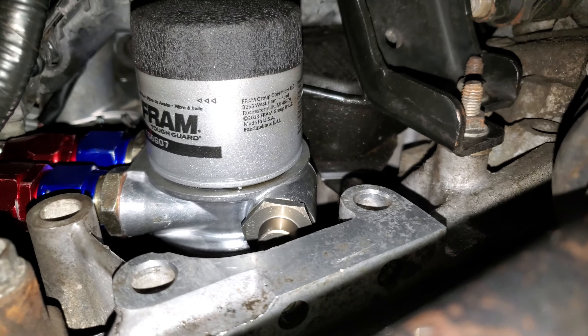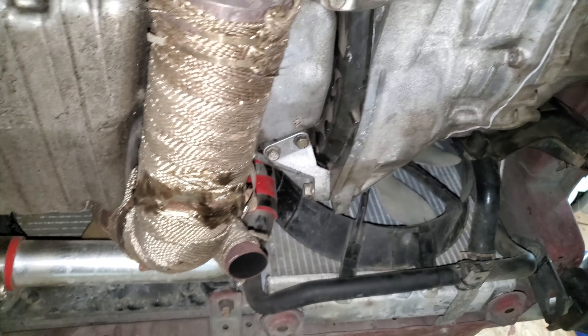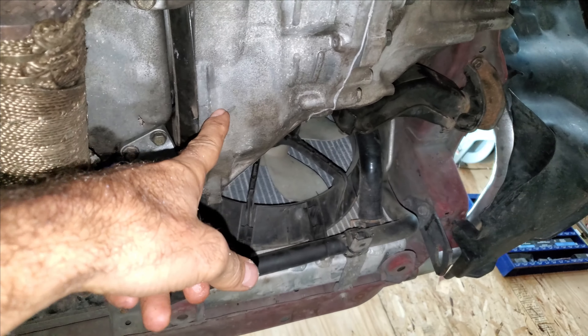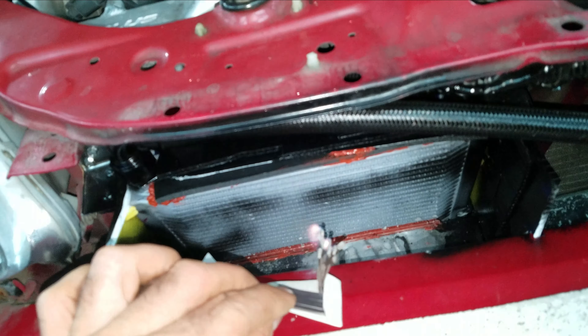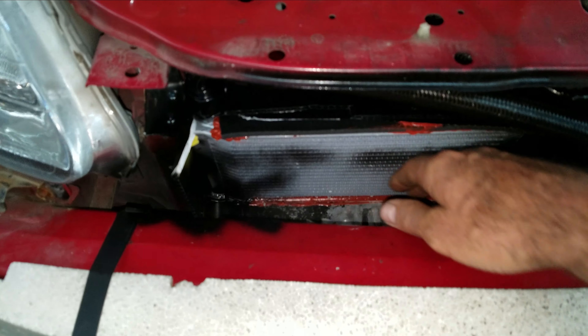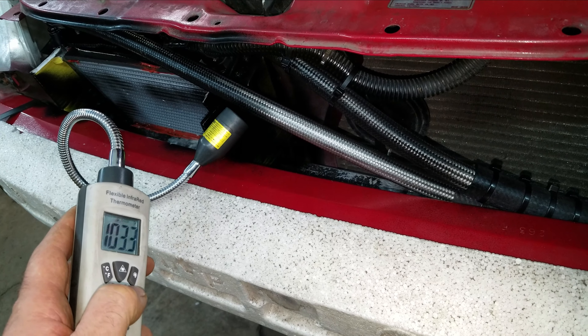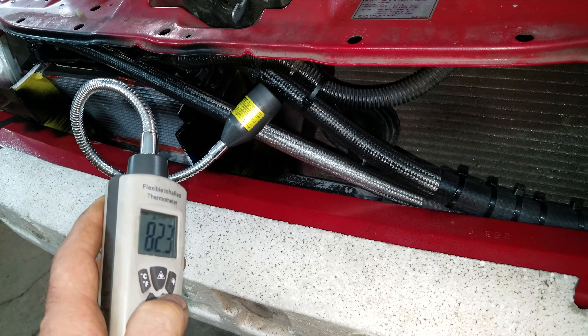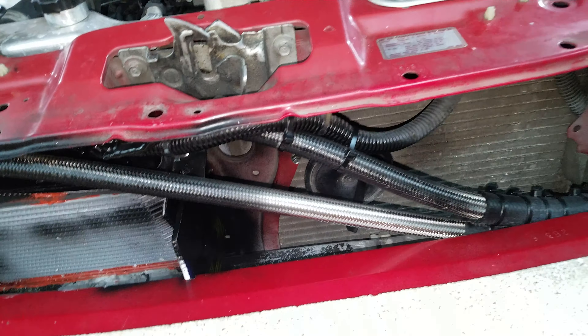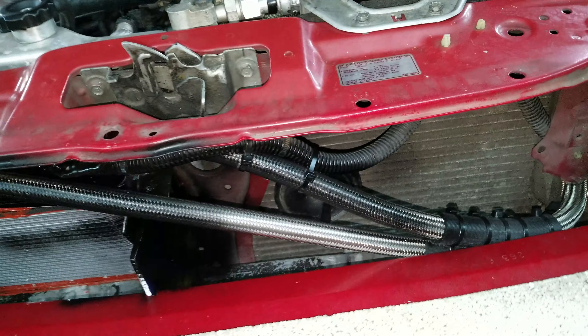None of these lines are leaking, which is nice. Now that I know it's not leaking and everything's fine, I'm probably going to do an oil change — I added like an extra quart and a half to get the level up. Then I'm going to change out the oil and transmission fluid and put that Torco fluid in it. Here's a good test to see if this works — I can feel it pulling air real nice with this fan on. I had it running for about 10 minutes: 105 on that one, 82 on that one. The thermostat probably isn't even open yet on that sandwich plate but it's still circulating oil and it's definitely working. Okay bye.